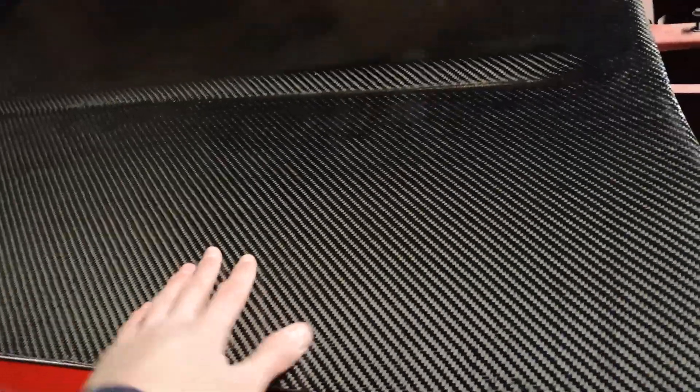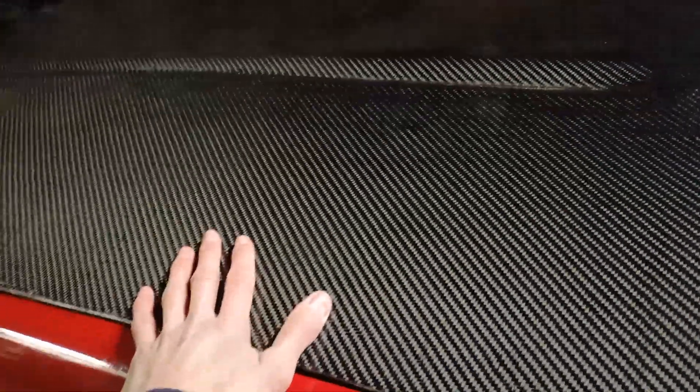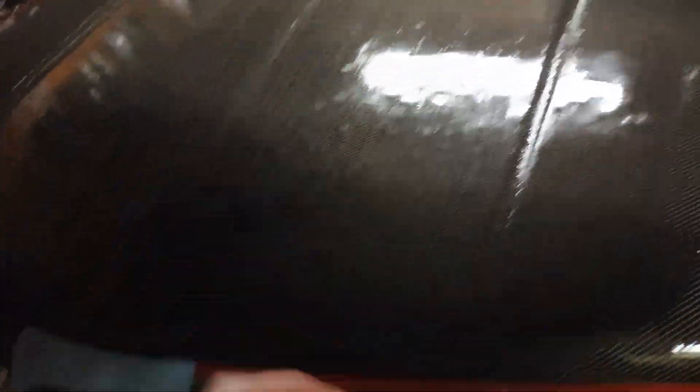This is not a wrap. This is Hexel fabric with the fiberglass 2000 resin, and then the clear coat on top of this is Cerakote MC160. This is the way to do it. If you guys want to learn about laying up carbon, watch Street Bandito in their 240Z build process. That is how I did this.